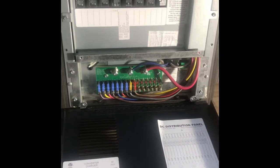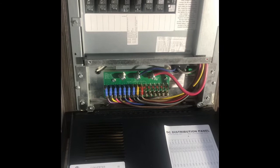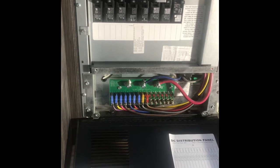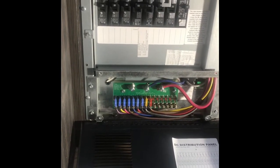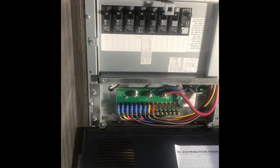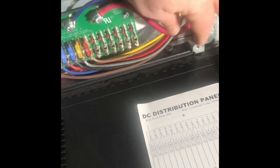So before we begin, there's obviously 2 key safety components. We're going to remove shore power, which is why I've got this shop light here that I've plugged in from my shop for light. We're also going to disconnect both positive and the negative on the batteries. Obviously, anytime you're playing with an electrical system and you come across the voltages that are present in here, you've got to take safety precautions. All right, let's go ahead and start the removal.